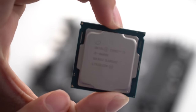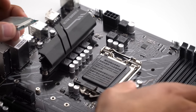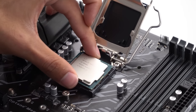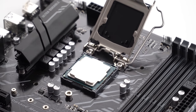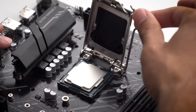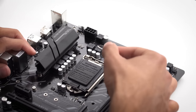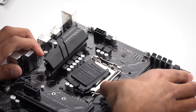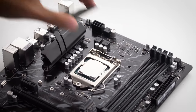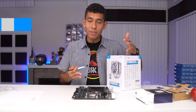In the bottom left corner of the CPU there's a little arrow — you're gonna line that up with the arrow on the motherboard CPU socket. Pull the lever to the right, lift it up, slowly place the CPU down, and it should just fall in naturally. Don't push the CPU down because you might bend the pins — no force required. Then put the lever back down, pull it up a bit to push under the screw, pull it down, and the top lid comes off. CPU installed.